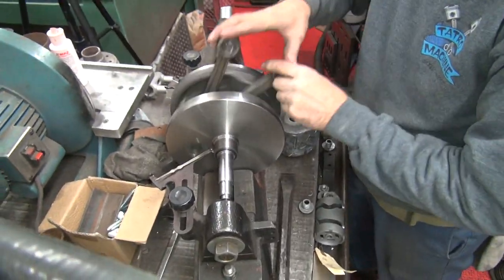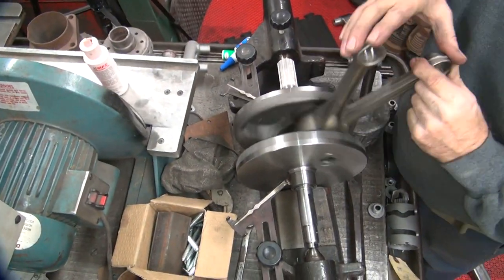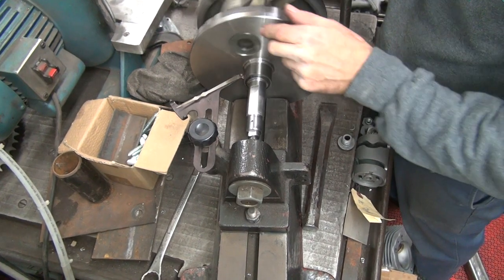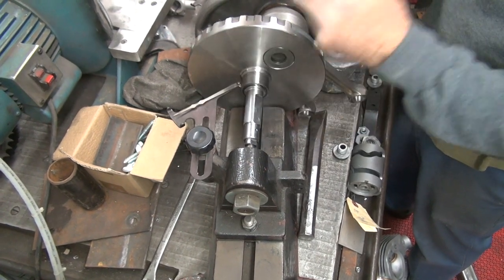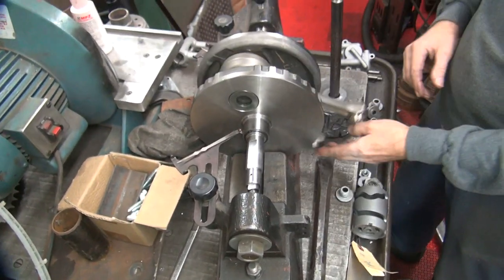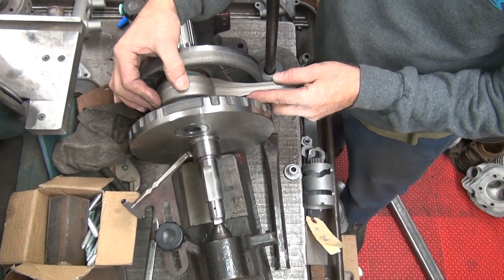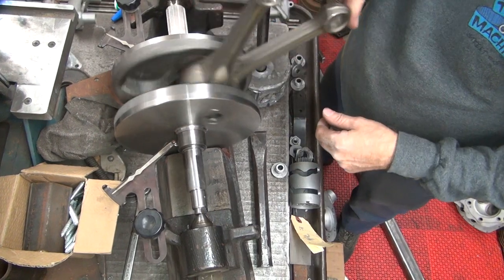I think that's about it — what do you think? Leave it alone? Do you think we should leave it alone? Leave it alone, knock it out. Which one's moving lower? That's where I come back to fix it and make it better. It's still high in the bottom and this one's still high right here. It's almost a 180 part — that's hard to get out, doesn't come out very easily. All right, we got it. Look at the end plate now since everything's true — we got 20 thou in there now, so that's good. Before it was all bound up.